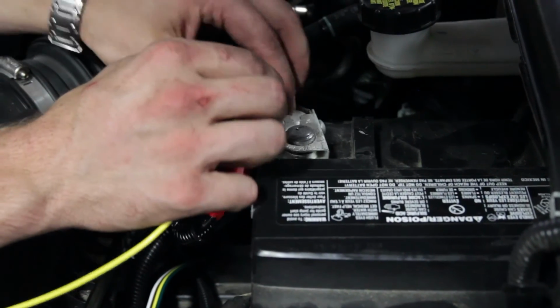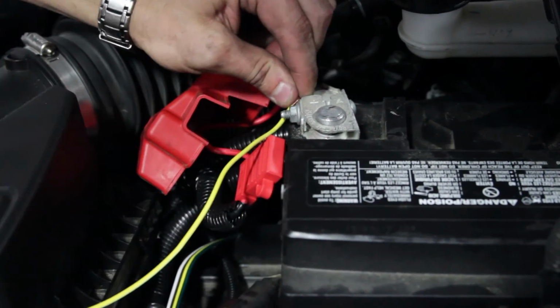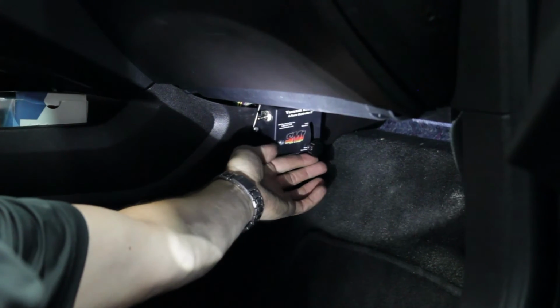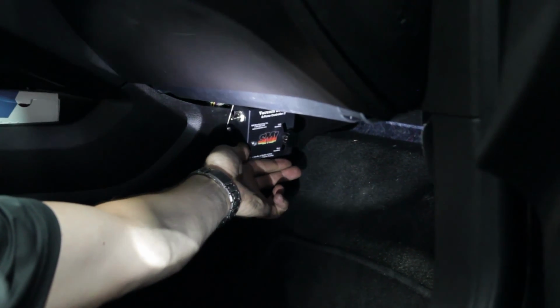If your motorhome is not available, you can still test the system by connecting a power source to the yellow or the green wire from the towed battery. With the system activated and the sensitivity setting all the way as low as possible, you will simply raise the sensitivity adjustment up until it shuts off. Then raise the adjustment up another 1/8 to 1/4 of an inch.